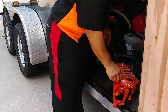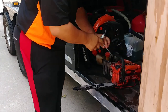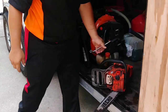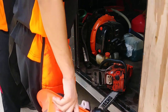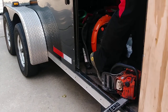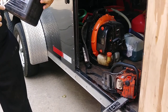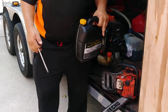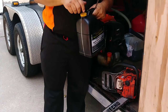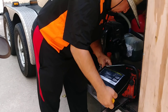This compartment right here — you can see it's black — this is for bar and chain oil, and as you can see it's empty. Look inside the chamber — it's empty. That means you can operate it but you're going to mess it up because it's not lubricated. In an emergency only you can use regular oil, but don't make a habit of it because bar and chain oil is different from regular oil and you'll mess up the gears inside.